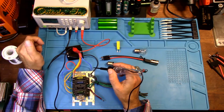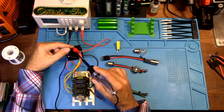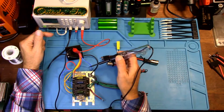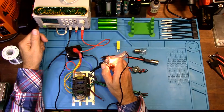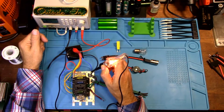All you have to do is connect one end of your light probe to the positive post of your battery or a positive source, then take this part of the probe and touch that piece of metal or bolt. If your light lights, then yes — that is a good ground.